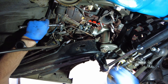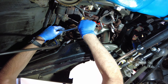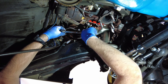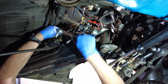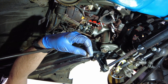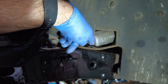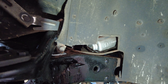There we go — there's one of the old sides out, which is awesome. Now I just got to do the top. That's too easy. And finally this one is coming out as well. So we've got both of the brake lines off of the proportioning valve. The big brake line here is easy to come out and I'm going to pull that out from the top. So with this out we've got the entire long line out, and I just pulled the short one out as well. Now we just have to pull that out and stick the new line in.